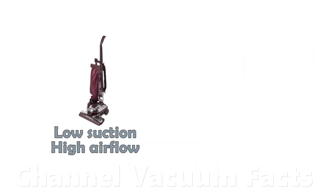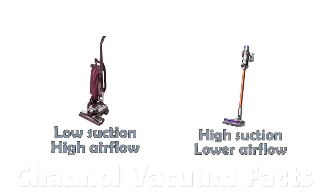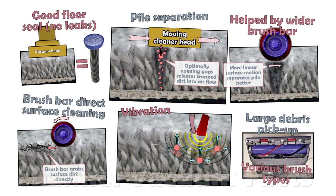The Kirby is a low-suction machine and can pull a large current of air at its open hose, or when its head is unimpeded by carpet. The Dyson V10 and later models are high-suction machines whose air currents are relatively lower at the open hose. This is often presented as an indication they can't clean as well, but this is very misleading, because it's focusing on numbers rather than actual performance — it assumes air flow is the only important parameter and ignores how well it's used by the cleaner head.